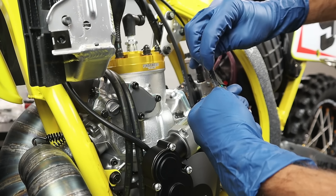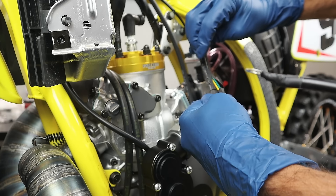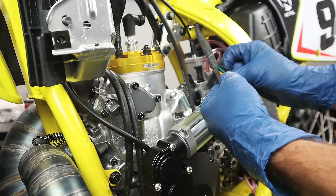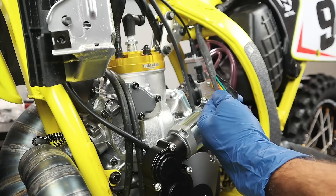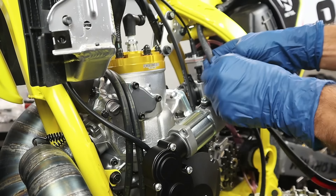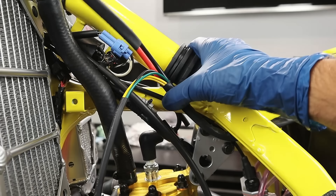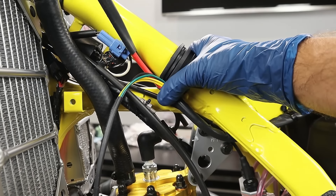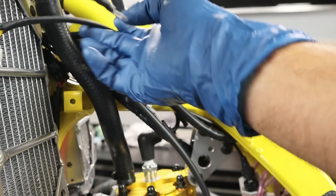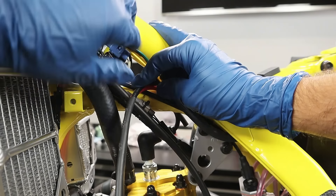What I'm trying to avoid is having this start to drop down and then turn back up. If I split the sheathing a little higher up, I can get it to Y right at the fastening point above, where the main power and negative wires split. Going ahead and doing some more careful razor blading — obviously be careful not to cut yourself or your wires. They actually make little utility knives with the blade tucked into a U-shape specifically for peeling cords and sheathing. Worked out pretty well. Now I can Y these a little sooner — the starter button wires can continue forward and at the same point the battery negative and positive cables go down.